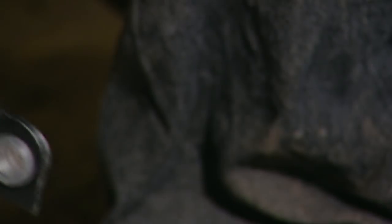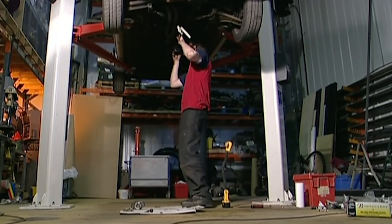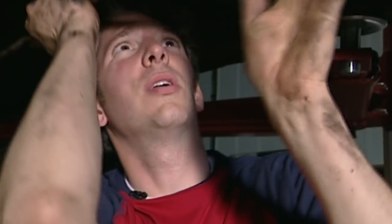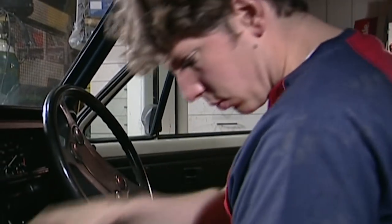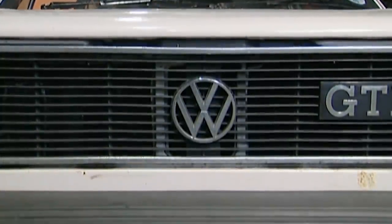Or even better, take a digital picture which will jog your memory if you get into trouble. Now there are a few more fiddly bits to put on after this, but this is the main bit — the main shaft is going back on the car. I'm just doing up the bearing carrier onto the bodywork of the car to hold it in place long enough to put the rubber boot up this end. Once the rubber boot is fitted, the car can be dropped to the ground and the gear stick reconnected.